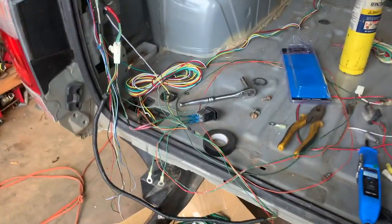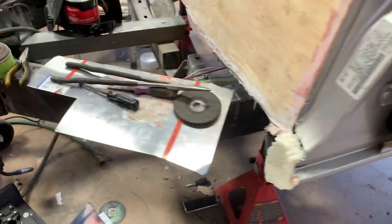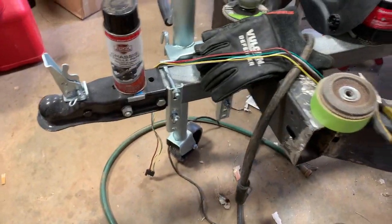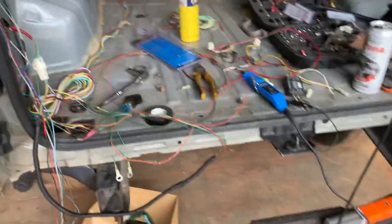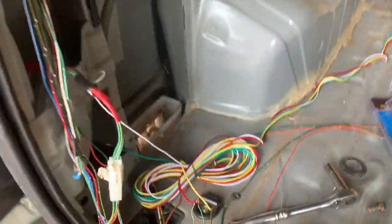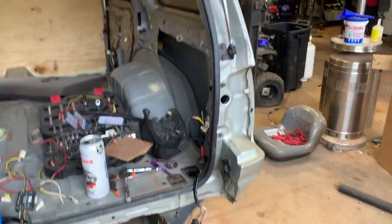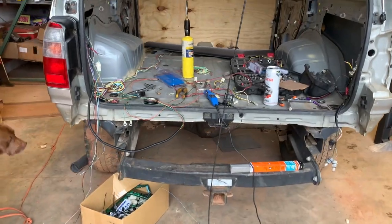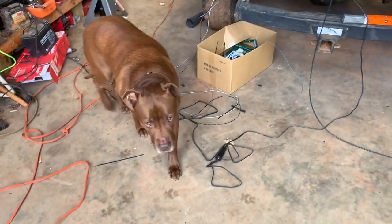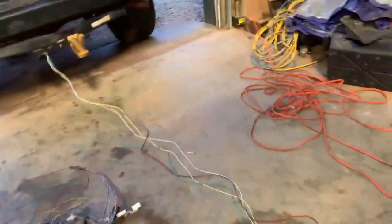Back to the taillights. I went to TriStar today and got the trailer wire. I ran it through the fuel pump up there, and it pops out. I'm going to run it along the frame of the front here. There's a little bit of excess but I will secure that down. Right now I'm just working on testing everything out, making sure all my wire connectors are good and all my bulbs are good on both sides. Slowly but surely getting there. We have things hooked up — this looks like a freaking mess — but we have it attached to Athena with the new wiring we're running.